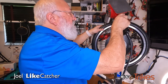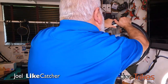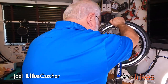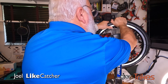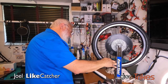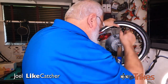The point of rubbing is over on this side now. And I'm just going to hold it like that for a few minutes, and you can feel it cooling in my hands. And I'm just kind of holding it there while it cools. And check. Much, much better. Over here it needs a little now.